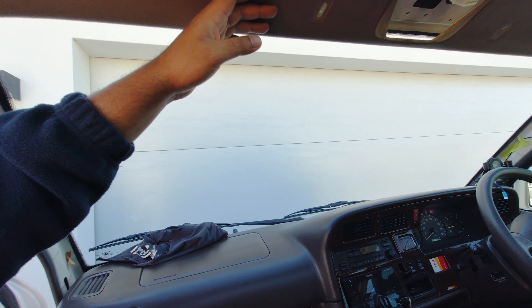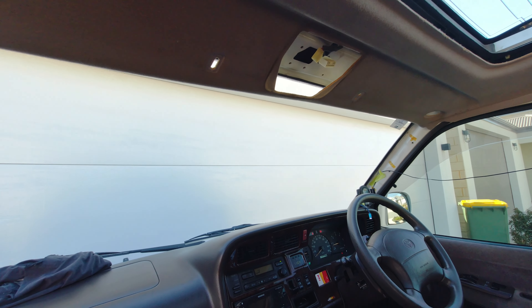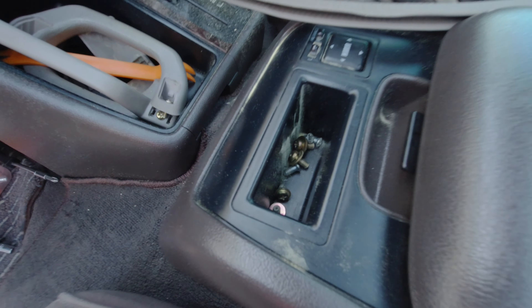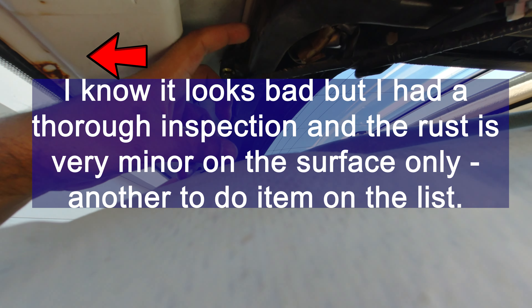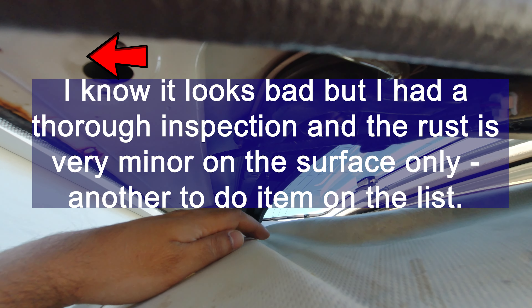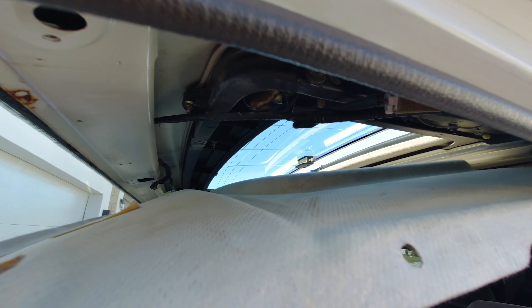The sun visors come out, the rear view mirror, and the dome light and map lights all come out as a unit — again all Phillips head screws, same screws as the others. Then you can get a pretty good look at the sunroof internals. This is that pan I was telling you about — this pan bolts up to the actual frame of the car, and then to the pan bolts the actual glass panel.